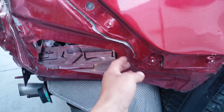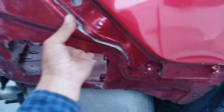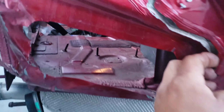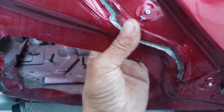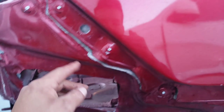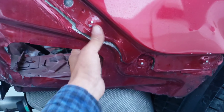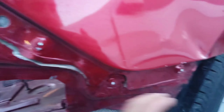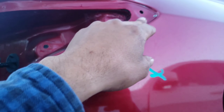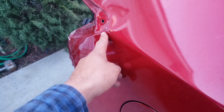Now the problem I'm having is this - I'm gonna have to tack this thing back in or screw it back on. The only thing it had was rivets and glue. You can see the rivets right here; let me show you the inside - you can see the other side of the rivets. The only things holding this panel are the polyurethane caulking and the rivets. I could easily fix that back up, but this little buckle right here is a problem. I'm gonna see if I can push this out a little more to get rid of the buckle.